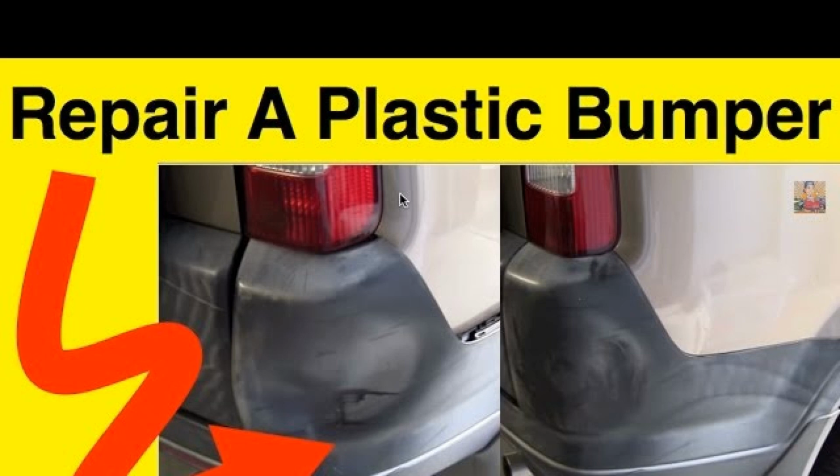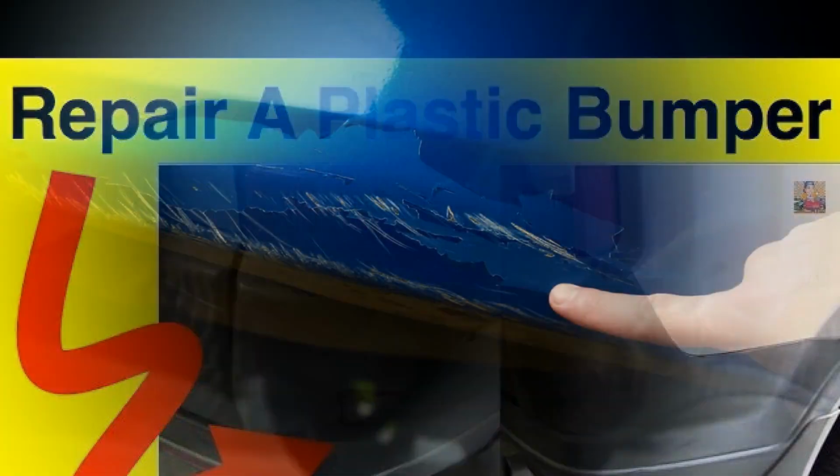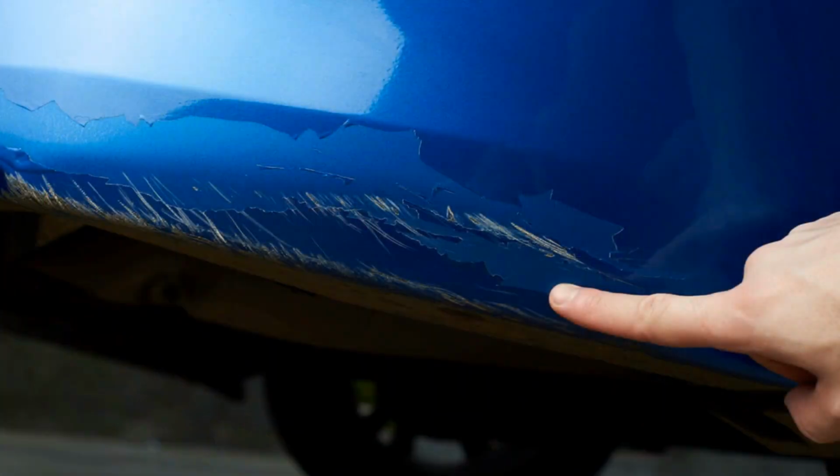How to remove deep scratches? Deeper scratches require a more tedious repair process. These are generally the kind of scratches that are deep enough to reach the metal panel, so trying to polish them out won't work. You'll need to fill the scratches before painting and polishing to the desired finish. You'll need: body filler, bumper repair kit, solvent, clear car varnish and primer spray, color matched car paint, mixed grain sandpaper, surface cleaner, anti-scuff pad, towel, paint stripper.